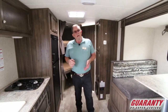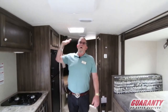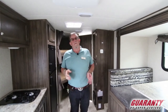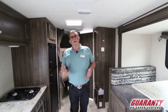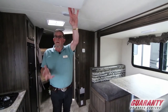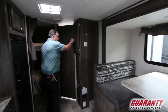Remember me talking about the laminated floor and laminated ceiling? They don't do this in your average trailer which has a truss roof. This is a laminated roof with all block foam up there, so I don't have to have two seven-and-a-half gallon propane tanks to heat my trailer. Think of it as being inside an ice chest — it takes very little energy to keep it cool, and very little propane to heat it up because it's all inch and three-quarter block foam.